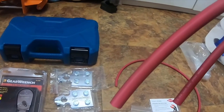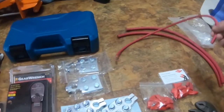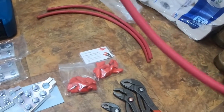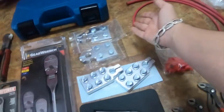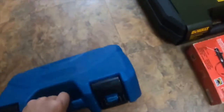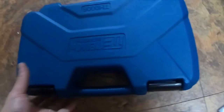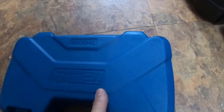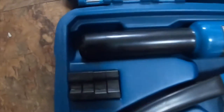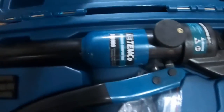I also got it in black but already installed that on the truck because I was fixing the battery terminals. This is 6-gauge I got for the truck — I haven't installed the hot side, I already installed the cold side. This over here is a Temco Industrial hydraulic large-gauge wire crimper; it comes with all the dies. I have 6-aught dies in it right now; I've used it and it works very well.